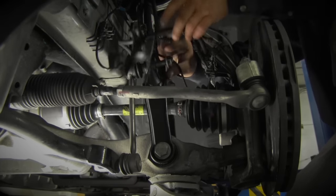Install, Step 5: Completing the installation. Reinstall the air compressor fuse. Lower the vehicle to the standard vehicle height from the lifting platform. Start the engine, then wait 2 minutes. Operate the raising function of the car's electronics. Initially lower the lifting platform slowly and only completely when the vehicle raises of its own accord. Installation completed. Congratulations — lower the car to test drive and check the installation.